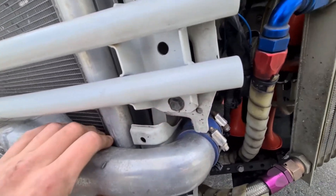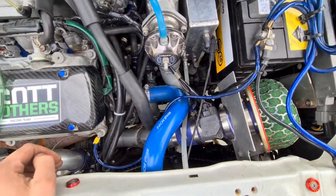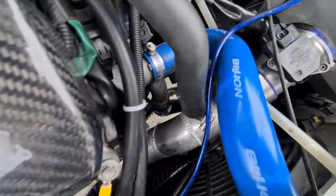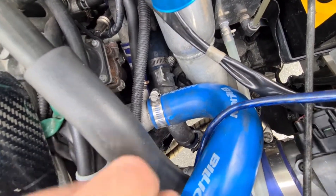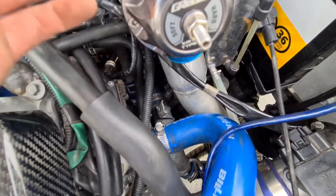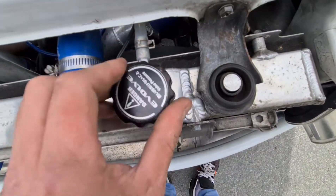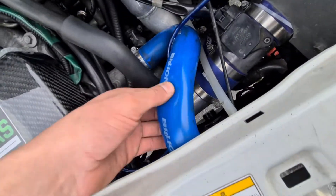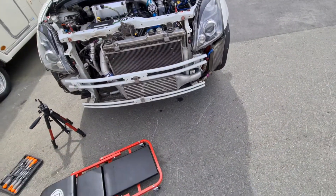These were loose and they're not now. Look at how clean just the top part of this hose came up — it's meant to be a nice blue color but it's all covered in crap. This one was loose, that one down in there was tight which I can't get to, so we have to hope it's okay. This one here was loose also. I'm going to take the cap off and squeeze the hose — look, I'm squeezing the hose and nothing's even happening. The coolant's not even getting to the hoses.